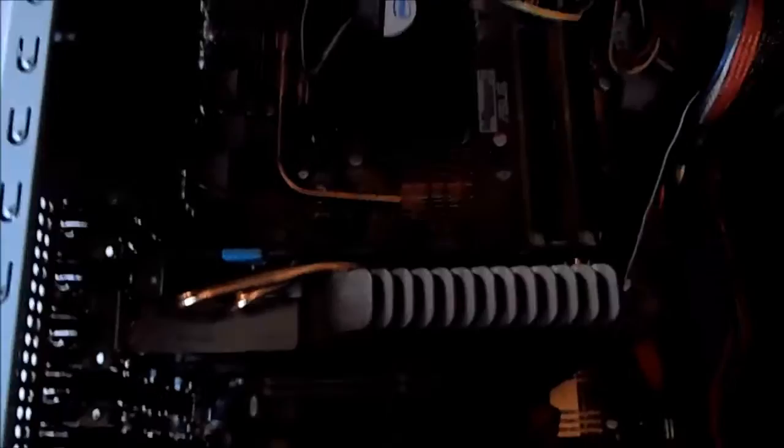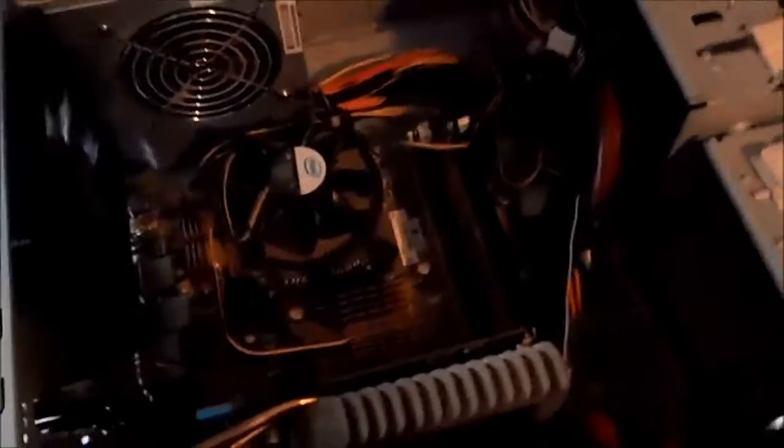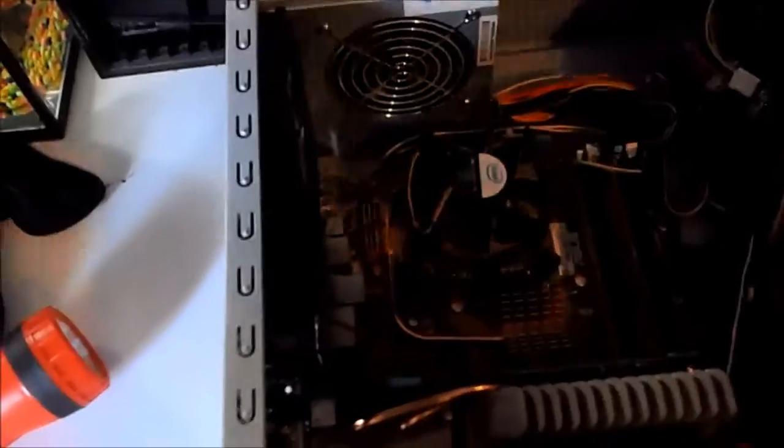I have my old computer propped up on my desk. To take the motherboard out, you have screws which you need to remove. Sorry about the lighting — it's not great in this room. This is a full-size motherboard, and the new one is smaller — I think it's ITX. So I need to reposition the standoffs.